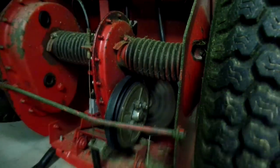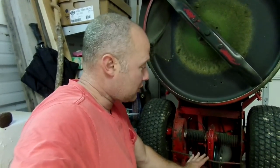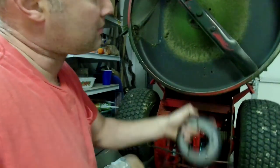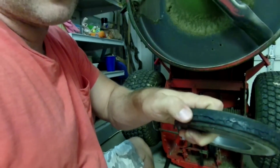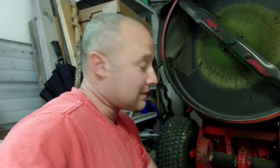So you see the procedure — just go around. I hope this has helped somebody. As simple as this seems, it was kind of difficult for me to figure out. I'm not a garage guy, I'm not a motorhead. I just want people to know you can do this yourself. If your Snapper riding lawn mower is not propelling like it should, it's very possible — just turn it up on its back and look at this little disc. If it's eroded like that, I can almost guarantee you that's the problem. This is the quick fix, it's the right fix. You will be cutting grass again within — I'll be out there in 10 minutes probably. Alright, thanks.